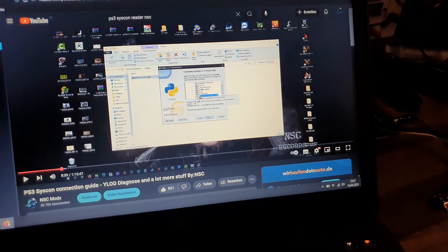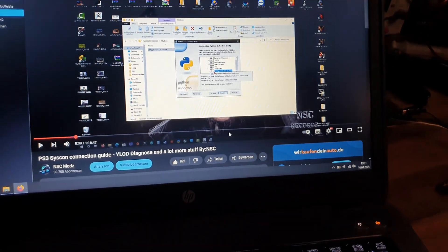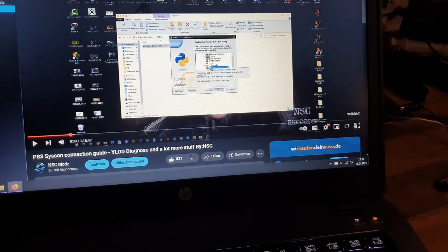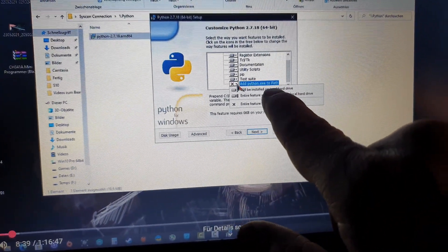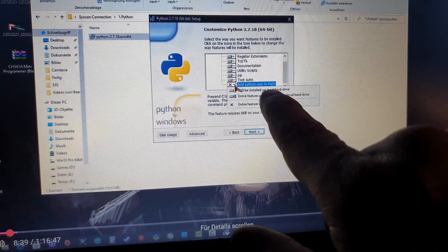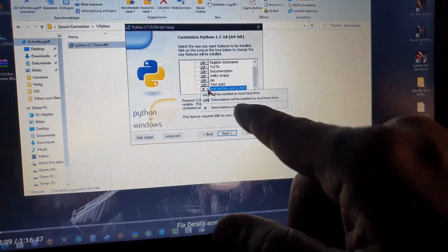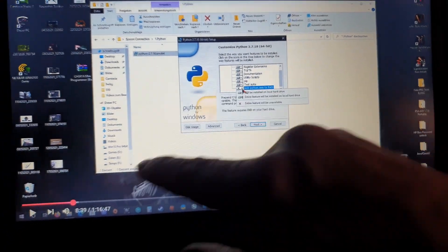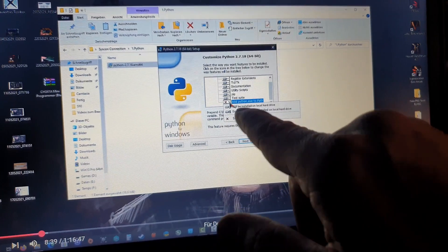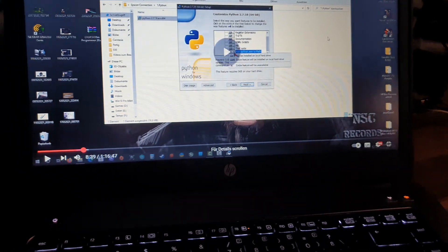While you are installing Python, it's very important — I'll include this in the package video as well — you click on the last option: 'Add Python to PATH'. This needs to be checked. It will make things easier and if you forget it you'll probably have some problems later. Also select the other recommended option shown during install.